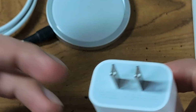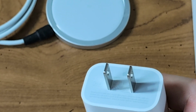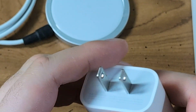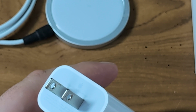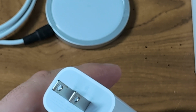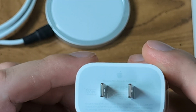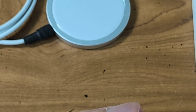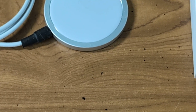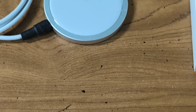Quick charging, which would be like Quick Charge 2.0, and then Quick Charge 3.0. 3.0 is super common. There are even still some phones that come out today that still have Quick Charge 3.0 support, as well as, you know, the modern USB-C PD. Almost no phones have Quick Charge 4.0 support, and I have one of the few chargers for that, which is the Razer Phone 2 charger. So this says USB PD output 5 volt 3 amp, 9 volt 2.2 amp.